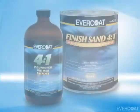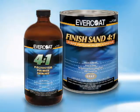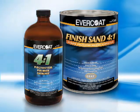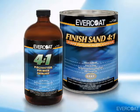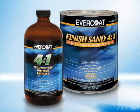EVERCOAT's Finish Sand 4:1 Polyester Primer is a two-component primer surfacer that has good filling capabilities and uses a patented 4:1 mix ratio technology. It is ideal as a low VOC substitute for urethane primers and for holding down troublesome repairs on fiberglass, SMC, and other substrates.